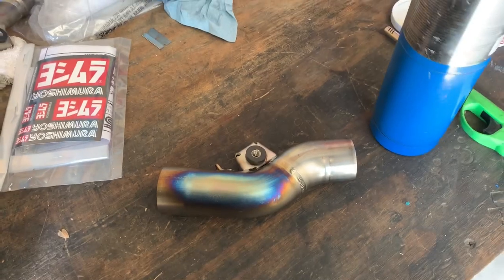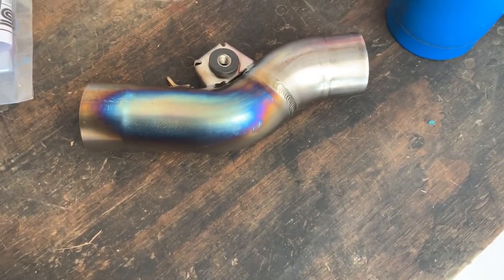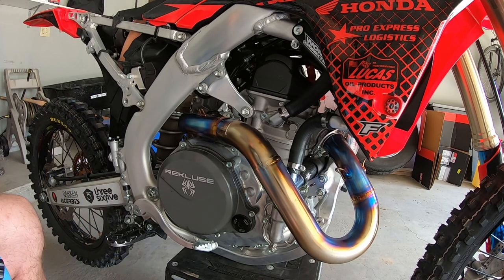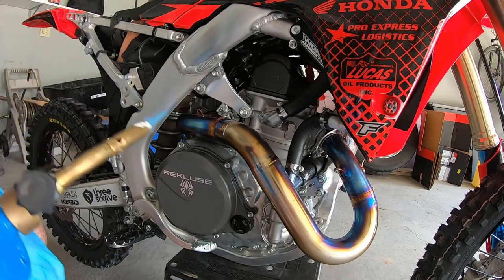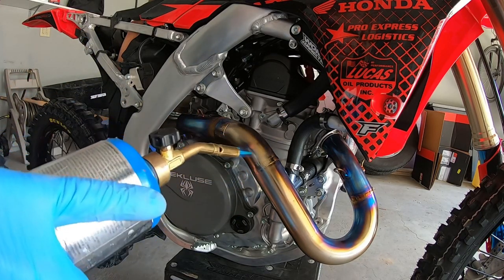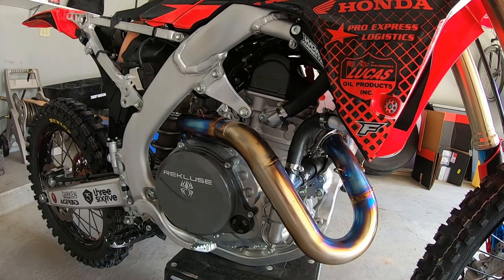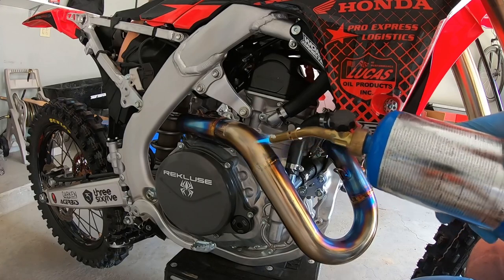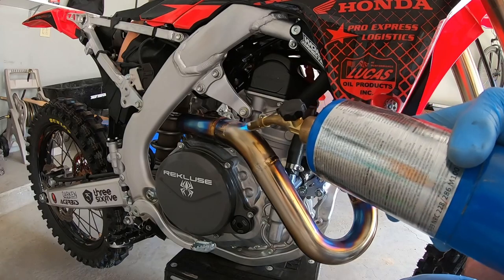Another thing is, people say that this makes it a little bit weaker and it won't have the strength, or it might be dentable a little bit easier. But I've never had it happen. Once you've got the pipe on the bike, it's a little bit easier because you're not having to worry about the air traveling up the pipe and getting your hands burnt and getting real hot. On the bike's a little bit easier. But you want to be careful not to burn these radiator hoses, because they are not fireproof — I've never done it, but I'm hoping that it doesn't happen. I just try to do it the same as before, a section at a time, trying to point it away. Try to do it in sections just the same as before, and try not to heat too much of the same spot, because I don't want it to turn past blue where it's back to the normal color.